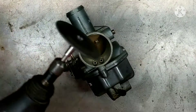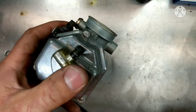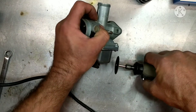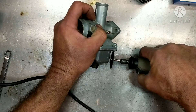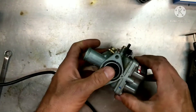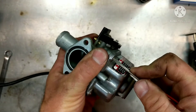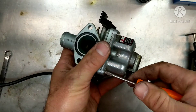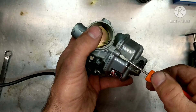There's only three of them on there, so I'm going to take the Dremel right here and just cut a couple slots. All the way down to the flat washer part of it — that's what you want to do, nice and deep so you don't have a problem getting them out. Let's get a screwdriver. I've got a flat head — make sure the flat head you're using fits good. These are not in there tight, so you can reuse them, or you can just change them out with a regular Phillips head. Having that big flat head in there makes it easy to remove and reuse.